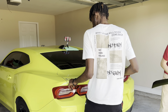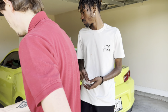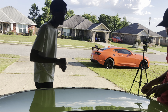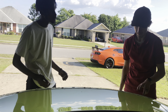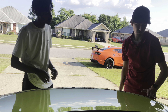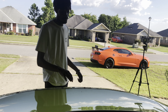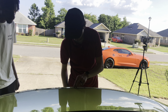All right, so I want to stick this back in your box. So people at body shops do fill these holes — yeah, you gotta find a good body shop. It's a pain because what they'll do — and I looked into this a lot because it bothered me — is they'll weld a plate in the bottom, fill it down with Bondo filler, sand it down, and repaint your whole trunk, not just that portion. I'm gonna see how it looks when we're done and then decide how urgently this needs to happen.